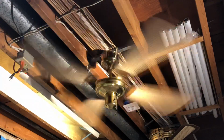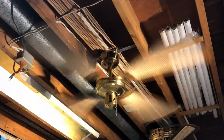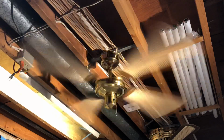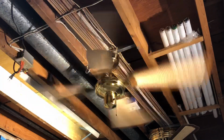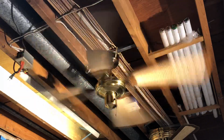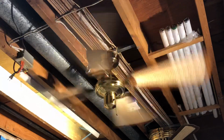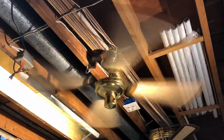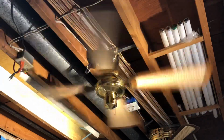Like I said, the blades are not balanced. They're just warped in all different directions. Of course, it is easy to fix this warpage, but that just takes time. As far as performance goes, I would say the fan runs around 200 RPM. The pitch is very minute, probably 12 degrees at the most. Fan moves an okay amount of air. It's nothing too dramatic, but it does alright for what it is. These were cool looking fans, but not top dog in terms of performance of the spinner variety. They probably would move a little bit more air if the blades were not warped, like I said before.